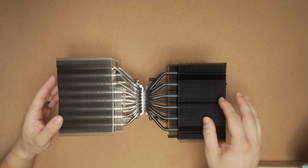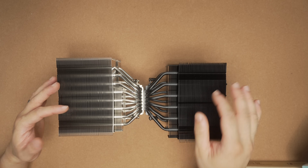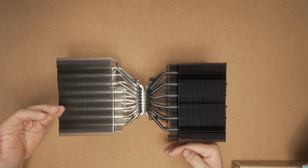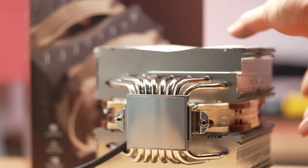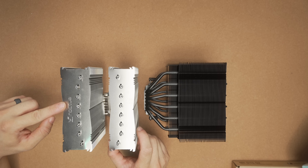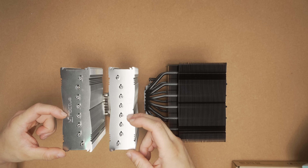Another thing I noticed when installing is that the G2 heatsink overhangs the bottom of the motherboard less. With the base plates aligned about their centers, the original D15 — not the S — actually sits a little bit lower. It is an asymmetrical heatsink with more material intended to be on the top. That will be more apparent when considering offset mounting for AM5 CPUs, since in that installation you would lower the cooler about seven millimeters, which otherwise would result in very tight GPU-to-cooler spacing. In some fringe scenarios, the old D15 would obstruct the first slot.